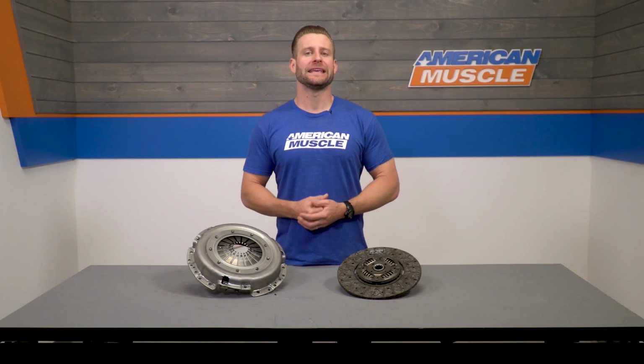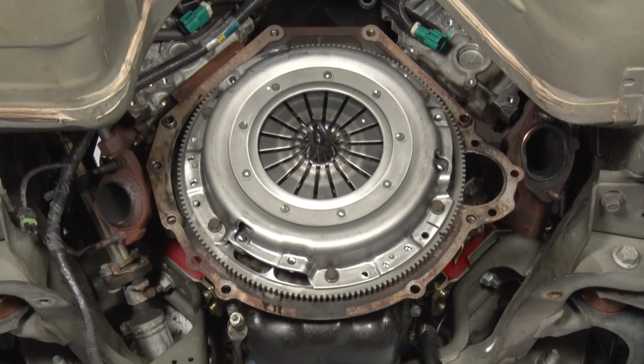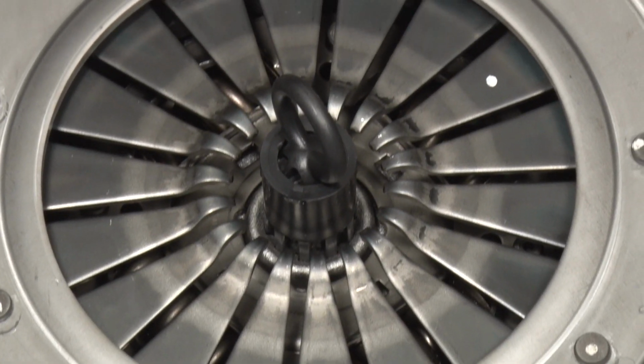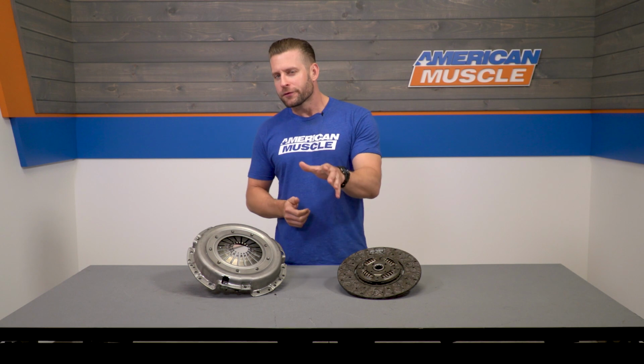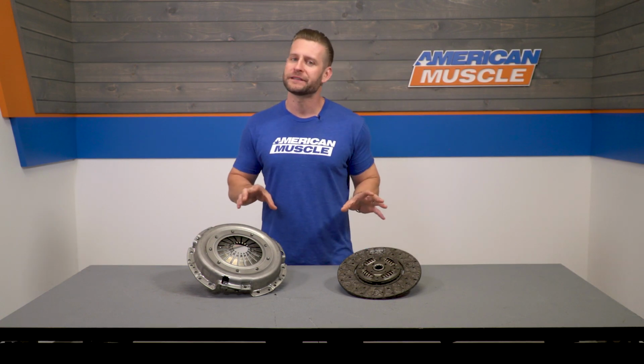And again, the big number to keep in mind, guys, is that torque rating of 510 pound-feet to the crank. So my two valve owners out there, this opens up this clutch for basic bolt-ons, maybe even some mild forced induction setups. 03 to 04 Cobra guys, I would watch your mods here because stock Eaton cars with bolt-ons should be good with this clutch.